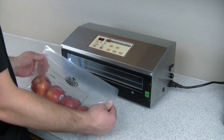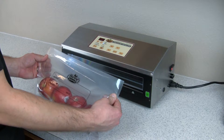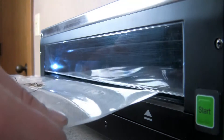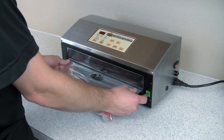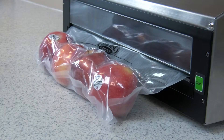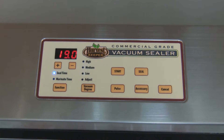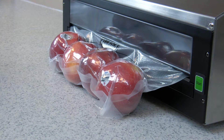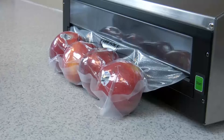Now that the settings are in place, it's time to seal. Cut the bag to the desired size, making sure you leave at least 2 inches of bag space above the item to ensure a proper seal. Insert the bag into the vacuum chamber space — it's important the bag is across the sealing gasket. Press the Quick Start button located near the vacuum chamber or the Start button on the control panel to begin. The machine will close automatically and begin its cycle. The numbers shown on the digital screen are the degree of vacuum being applied. For example, Low on the digital display is 23, and the vacuum sealer will count up until this target number 23 is achieved. Once hit, the machine will automatically go into sealing mode, and the digital display will count down based on default or customized sealing time settings.